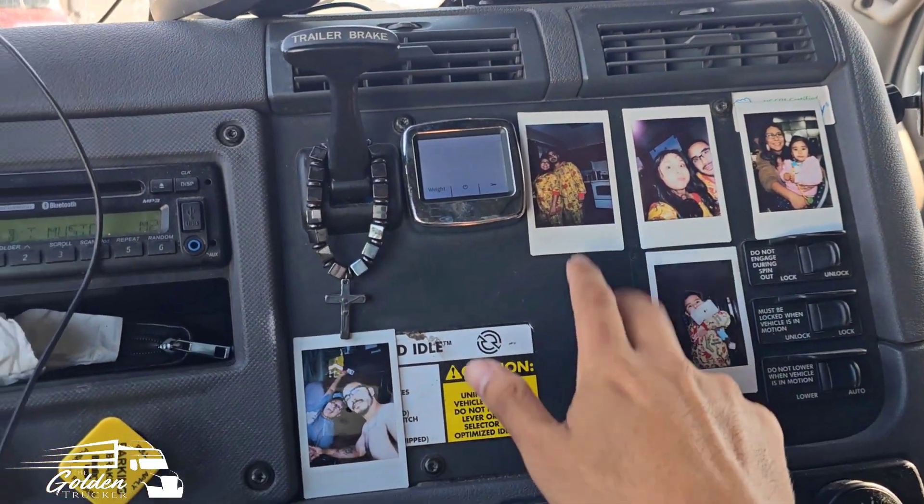I'm going to take out the CPC4, which is located behind this panel. I'll inspect it — I've seen articles online saying one of the pins can become corroded, and that might be an easy fix. Essentially the CPC4 is having trouble communicating with the truck. A couple days ago this happened, the check engine and ABS lights stayed on. I pulled over and used the truck's kill switch to disconnect from the battery, turned it off for a few minutes, then turned it back on and the lights went away.